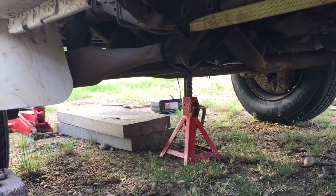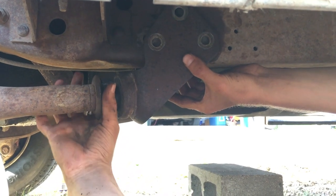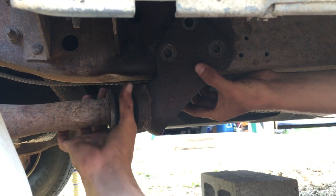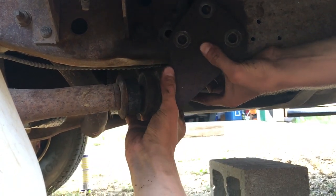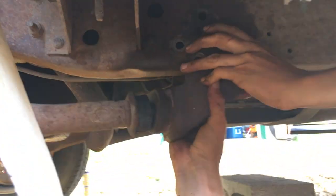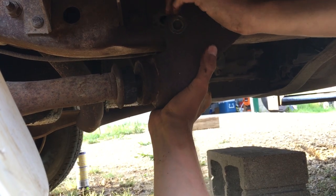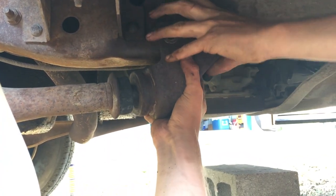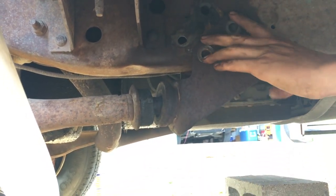What I did last time when it didn't come off easily was take my knife and cut all the way around this bushing until it eventually just popped right off. So I'll spend a couple minutes cutting this off. Once you've cut all the way around, you may have to hammer it a few times to loosen it up, then twist the rubber to make sure you're completely severed. Then wiggle and pull to get it off. This one was a little harder because there are some brake lines on the upper side, so be careful with those.